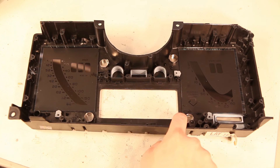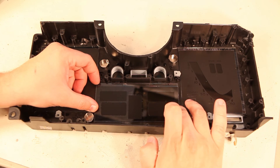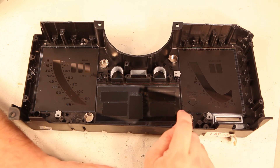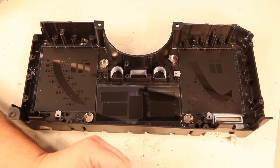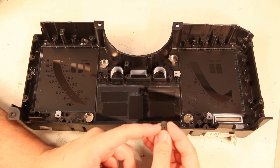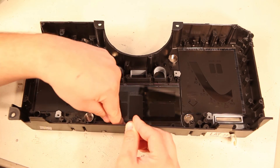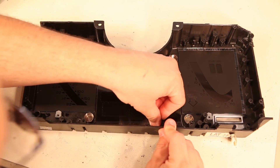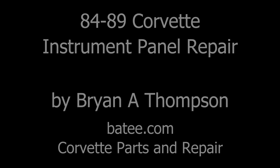When we reinstall the center panel, we're going to be very careful to move this metal clip to the side of the new panel when we put it in place. We want to be very careful not to set the new panel on any of the plastic blocks which index that panel, and very careful not to set it on top of this metal leaf spring. When it's absolutely flat against the housing, we will reinstall the rubber blocks that hold the panel in place. We'll make sure that the side with the step and the lettering faces up when we put those in place. And that's all there is to replacing a panel. Thank you.